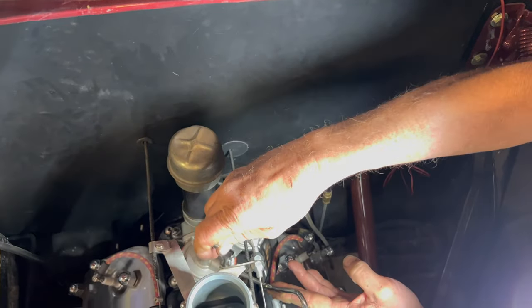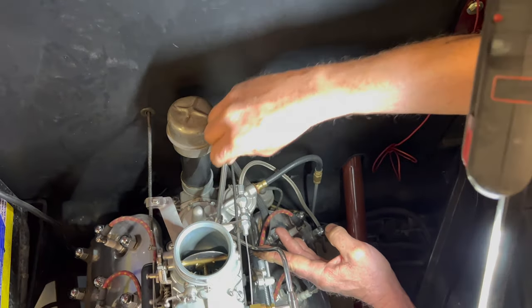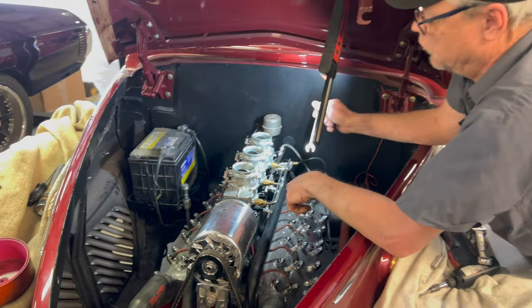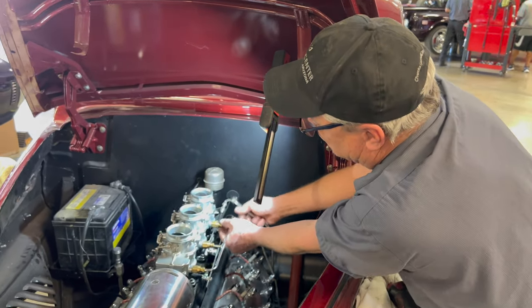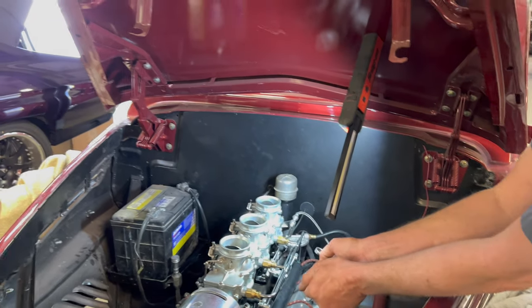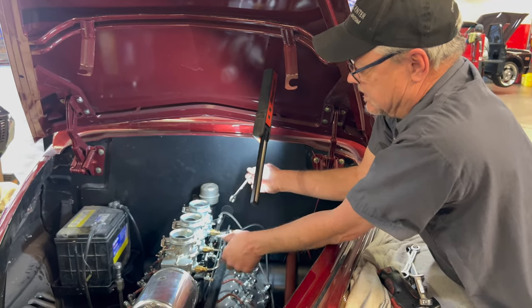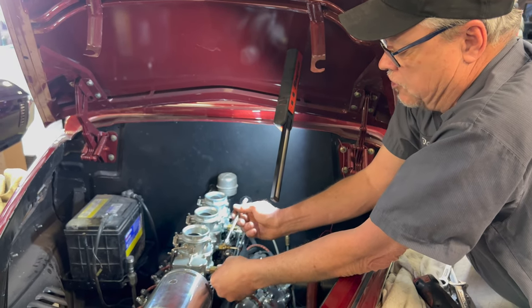The guy you talked to, Dave, is the one that made all of the linkage and the fuel log for it. He's the one that actually gave me the heads up: if you're going to pull the carburetors off, pull the whole fuel system as one unit as opposed to trying to squeeze it out, which I've run into before, but it was nice to have the heads up. Well, it's homemade. If you try to squeeze one out, then what happens? The line bends, and then when you go to put it back in, it's not going to fly, and it's going to leak. So it makes more sense to take the extra 2 minutes to pull it all off as a unit, as opposed to trying to cheat it out.